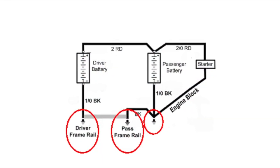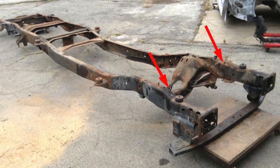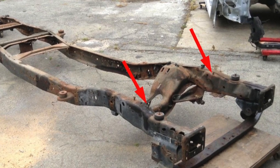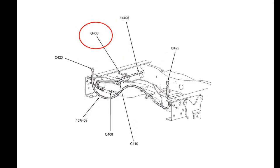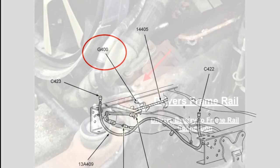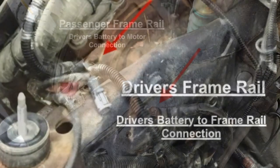Ford uses two components as ground planes. When we look at Ford's schematics for the electrical system, there are two connections to the frame to link the two batteries together. The frame is also used as the negative pathway for lights and trailer connections at the rear of the truck. These connection points down on the frame become less than ideal over time and should be cleaned to reduce voltage drop.